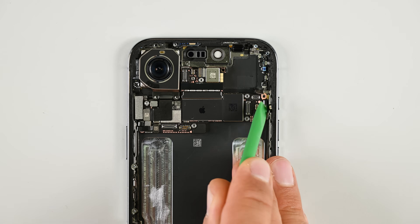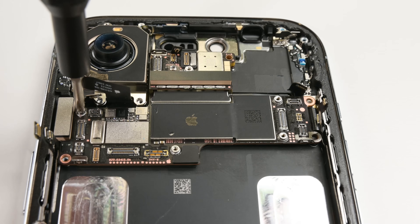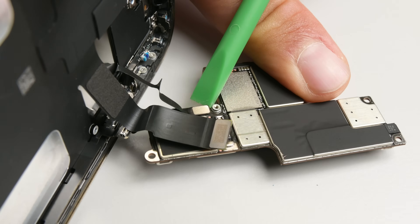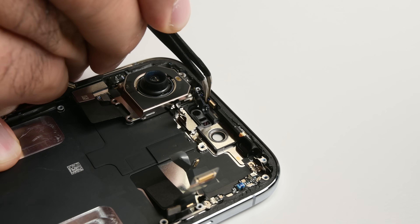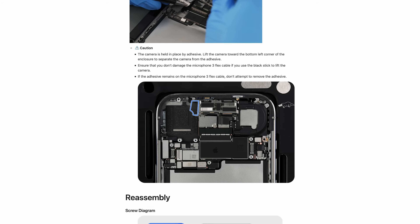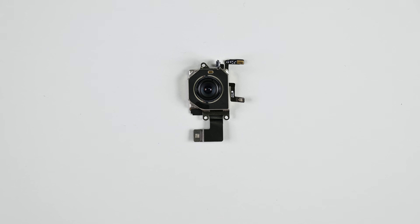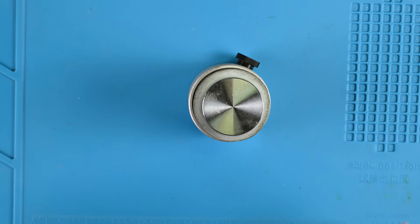I go around the logic board and disconnect every press connector, remove the two Phillips screws in each corner, and finally the standoff screw in the top left to release the logic board. Folding the board out reveals a bracket securing the press connector to the screen. Once disconnected, I can remove the logic board. But first — let's get that pesky screw buried in the top frame to remove the camera assembly. With the frame out, I can finally peel away the flex cable and remove the camera. Bear in mind Apple had guides for this phone on day one, which our team didn't see until after we'd sweated through it. Turns out all that disassembly was unnecessary — all I needed to do was gently pry the module up.